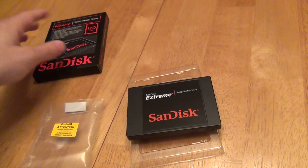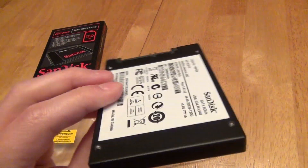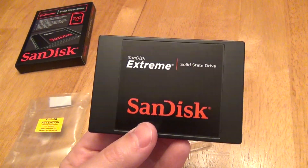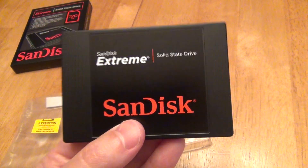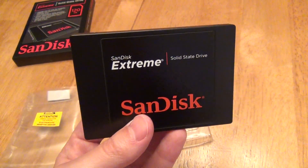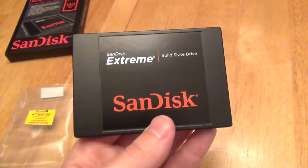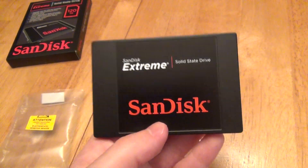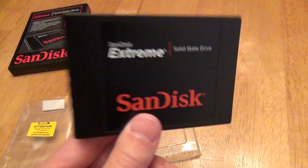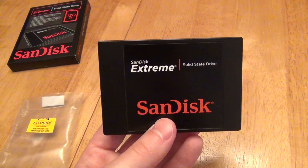If you're not doing an upgrade, don't worry about it — this drive is perfect, it works great. There are differences in quality of solid state technology, and Intel is known to be one of the superior ones. I don't know what SanDisk actually uses inside, other than that the cost is suspiciously cheap. But what does it matter for a home PC if it actually is faster, and I found that it did prove results? If you use the EZ Gig software, make sure you check the advanced menus checkbox that says 'align to 4K.' If you're using CloneZilla and other tools, some say it's not going to perform as fast as it could.